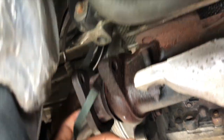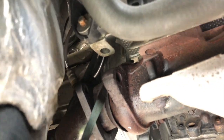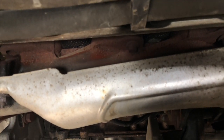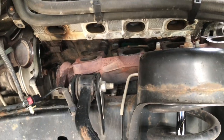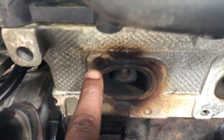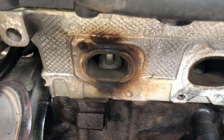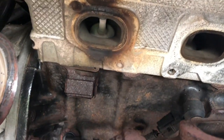Another thing I found was the ground wire — I guess it got too close to the pipe. You can see the other half back there; I'll fix that while I'm under here. I'm about to remove the shield and show you guys the manifold. Okay guys, I got it off and it's the worst case scenario. Look at what's happening — both bolts are broken off flush. The exhaust is seeping through the pipes, hence the burn area.